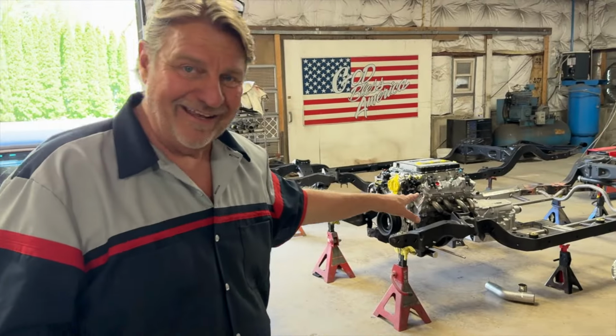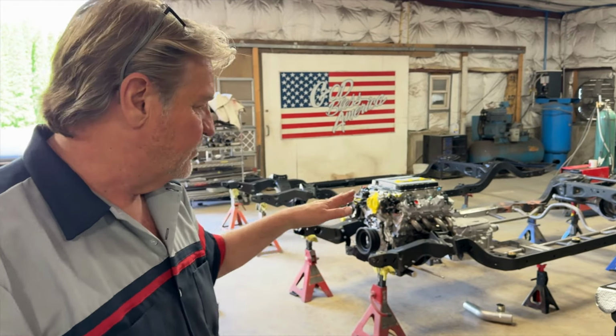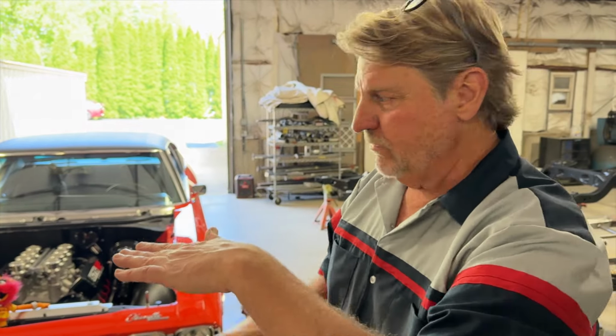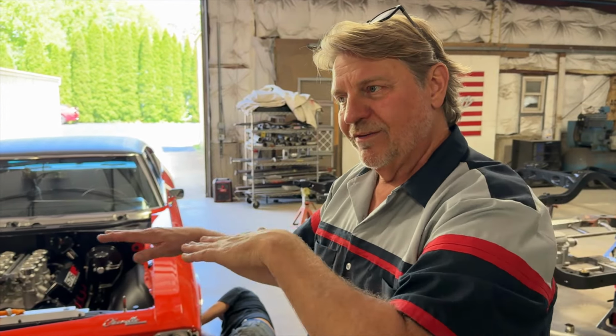That motor and trans, talking about the final fitment and placement of that thing, super important because we got to sink it in the weeds. The customer's name is Chad, and he wants his car to ride sunk down in the weeds a little bit. We're doing a final check right now on the clearances of my car. So you know, you got to split the difference between the height of the motor with the hood and the height of the transmission and where it lands into the frame.